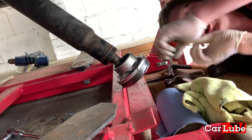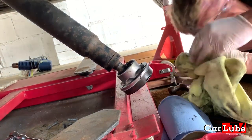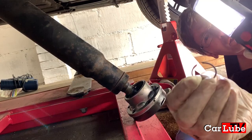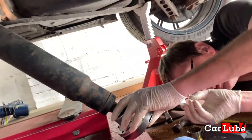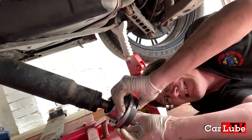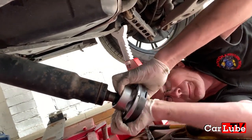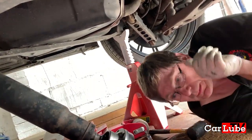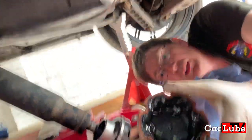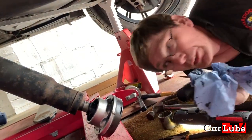Yeah, I can feel it now clonking rather than moving, so it must be at the edge of its travel. So that's what the spring clip looks like. Literally springs over the shaft and sits in the groove. He says with great confidence. Like that, in we go. Now, clean that mating surface so the new cover can go on. So we're replacing that with a brand new one, mainly because the cork, once it's been compressed, won't work again.